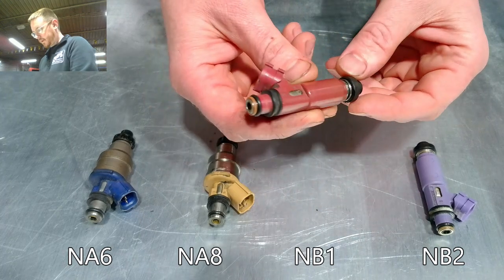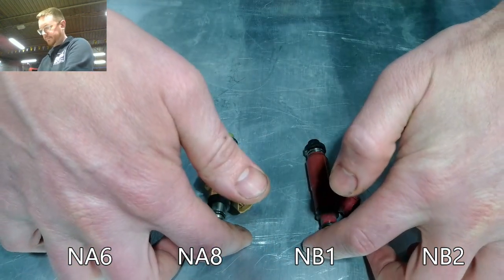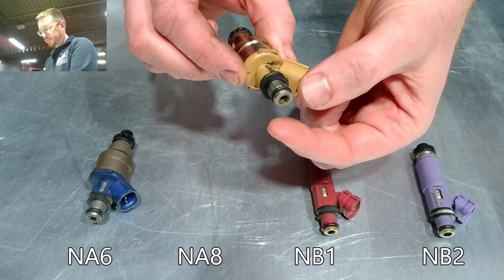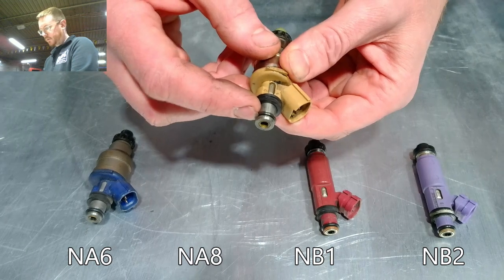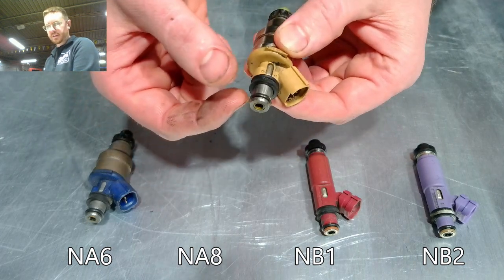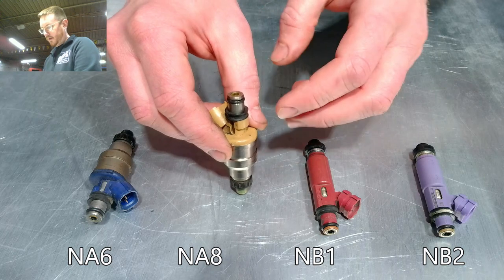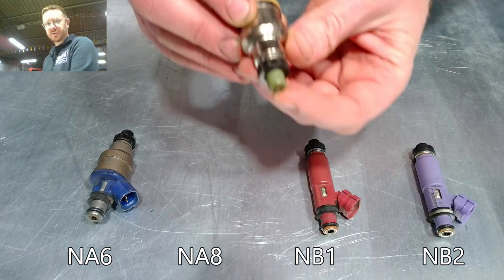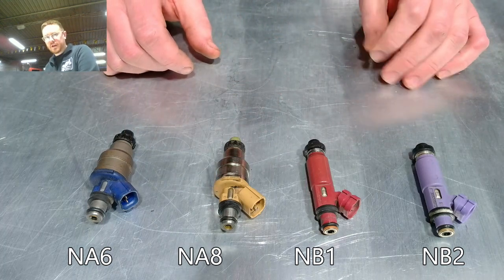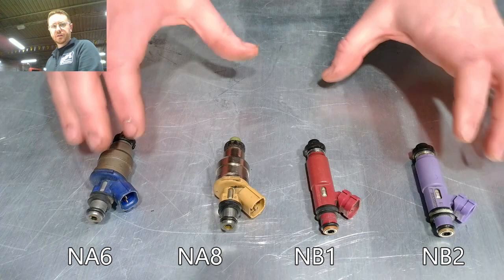When installing the injectors, it's kind of awkward because they fit down into the manifold and the fuel rail goes over all of them simultaneously, so you need to get them all lined up. When sliding the fuel rail on, it can nick or cut the o-ring. What we do is put a little bit of grease around the o-ring — just normal axle grease, a thin coating — just to make it a little easier for the o-ring to compress and slide into the fuel rail. Similarly for the bottom end: if you don't get it lined up perfectly, when you start tightening down the bolts it will jam the tip of the injector into the intake manifold and can damage it. There's nothing difficult about installing them — you just have to be very precise and careful, and it should all press together gently. Once it's fully down and seated, then you put in the bolts.